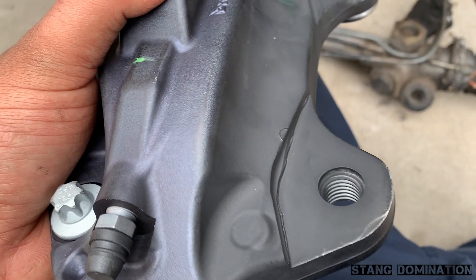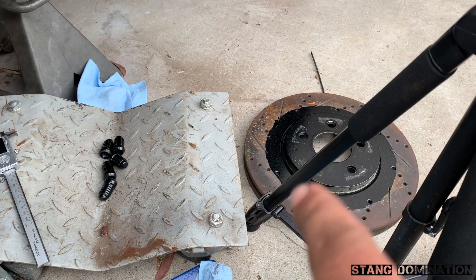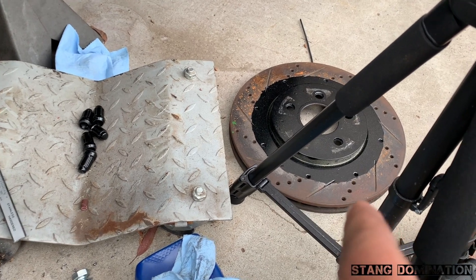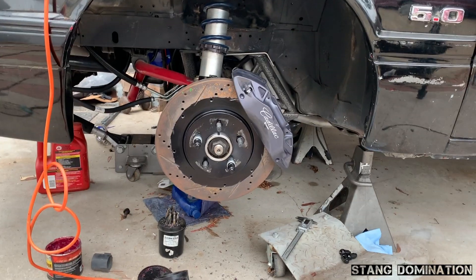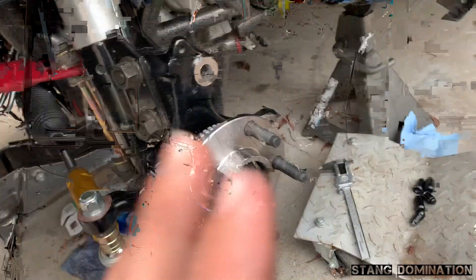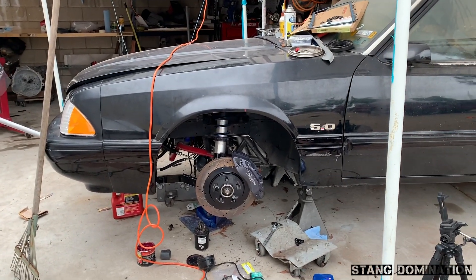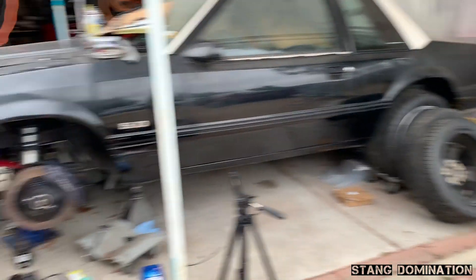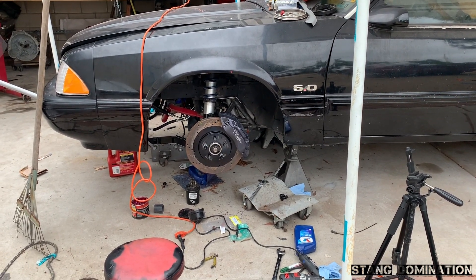Isaac's video should show the reason why you need to shave that down. Now I'm going to get these rotors resurfaced — you keep the stock rotors and get them resurfaced because you don't want vibrations when you hit the brakes. The pads are a little bigger, so the wear line is higher — you don't want that. Get them resurfaced and you're good. Slapping the rotors on now just to see how the 13-inch rotor looks. Red is really outdated and overrated, everybody's got red. I don't know — maybe yellow? Give me some opinions on the color.